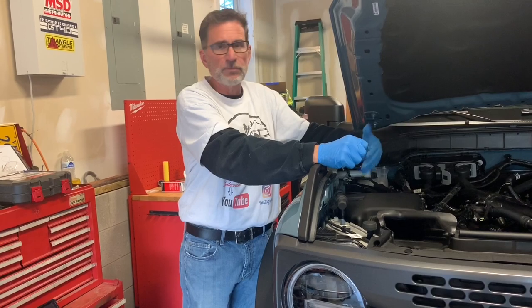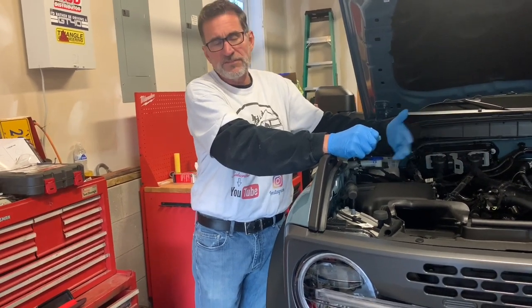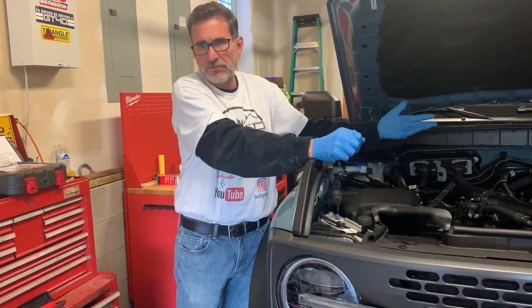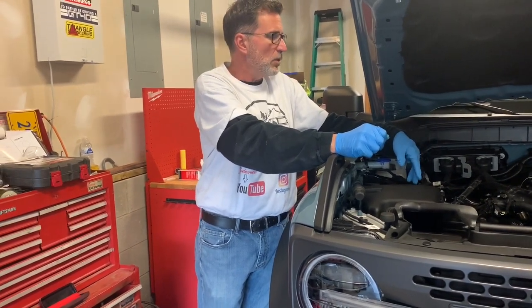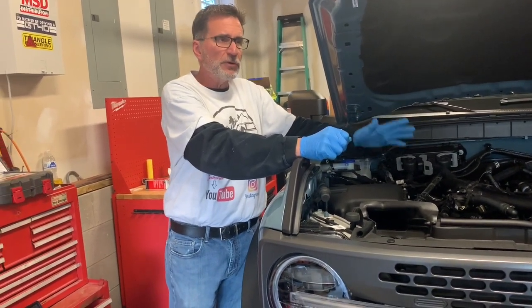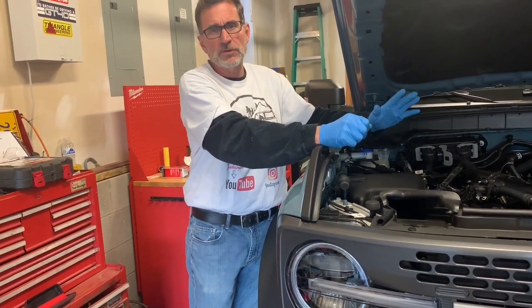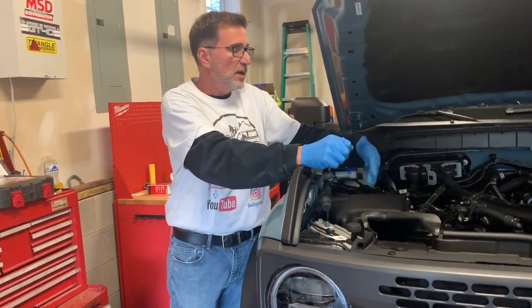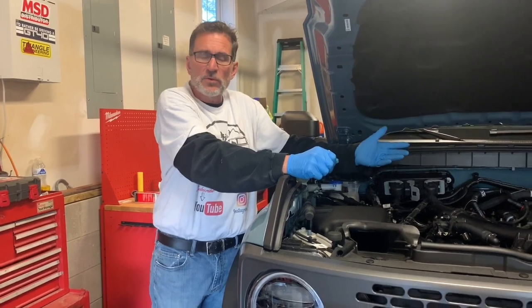So when you crank it up, run it, you turn it off, wait 15 minutes and drain the oil, you might only get the 6.25 quarts of oil out. So that's where it is. So there again, this oil change was done for experimental reasons only. Obviously you don't have to do all this for an oil change, but this just kind of gives you an idea of what's going on with the 2.7.